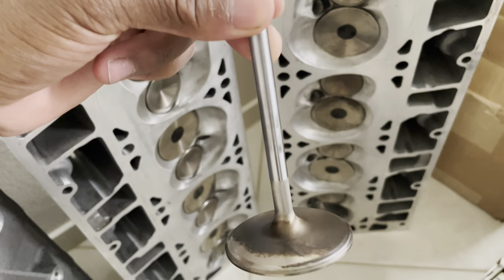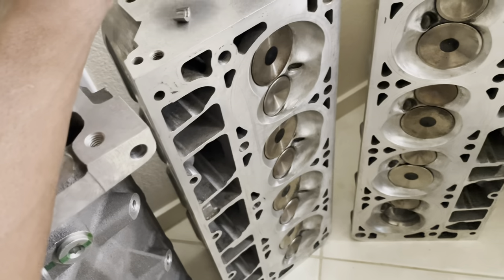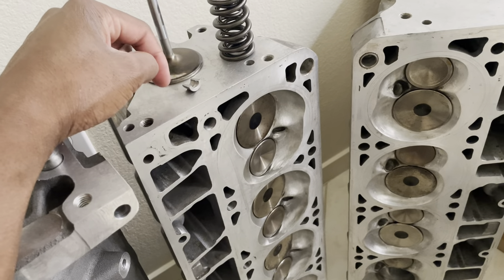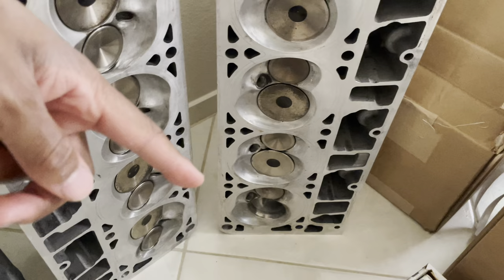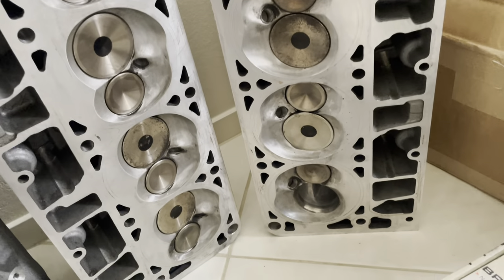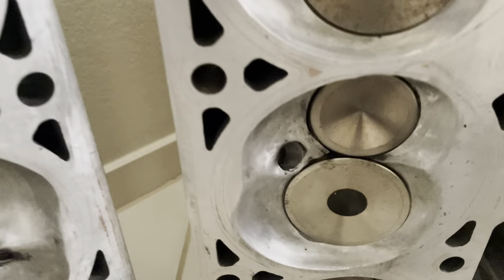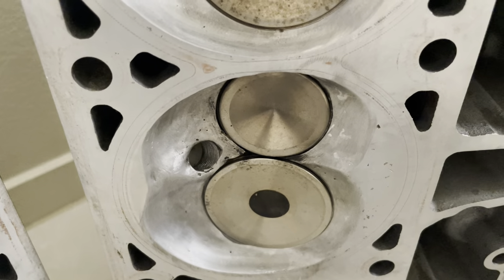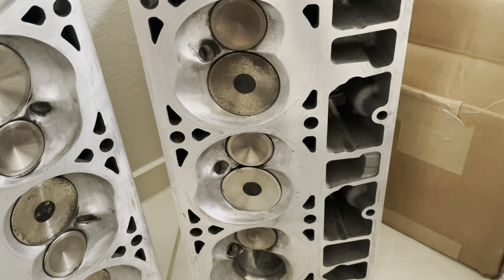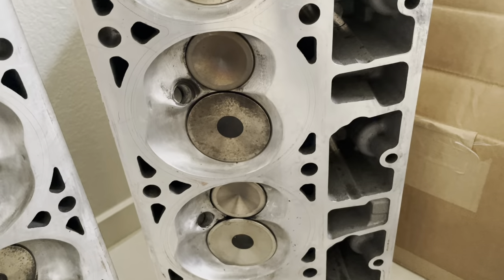Here's one of the valves — titanium. As you can see it is fused together down there. They lost a keeper, so we need another one of those and that cylinder can get put back together. These heads were damaged before. I'm trying to find it so I can show you guys — this one, it was repaired. How well? We're going to find out. This has got to be the cylinder where a valve was dropped, because it is not the same as the others. If you look closer you can see. But we're going to run it and see how it does.